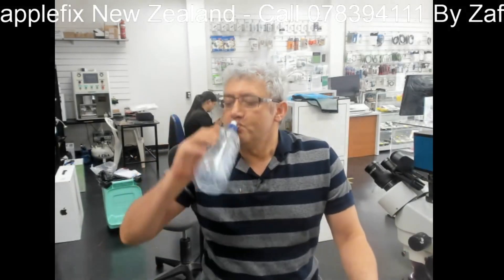Hello guys, I am here with another repair which we will be doing on Samsung Galaxy series. This is Samsung Galaxy S7 phone and the charging port is broken. These Samsung Galaxy phones are a little bit harder to replace the charging port because the whole charging port flex cable, the home button and the back button go inside behind the LCD, so you can't just replace the whole flex cable. You have to replace just the charging port.